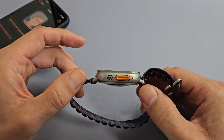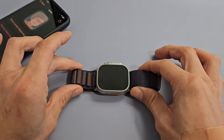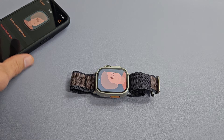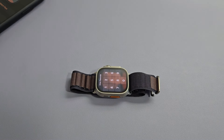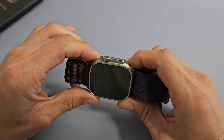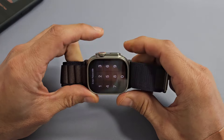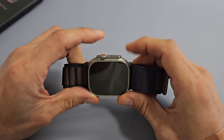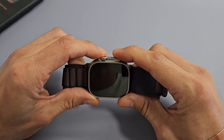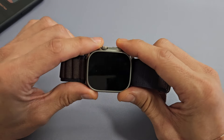What I want you to do is grab your Apple Watch, go to your freezer, put it in your freezer, and leave it there for 15 to 20 minutes. After 15 to 20 minutes, grab your cold Apple Watch, then tap one of the buttons and see if your screen is on. If not, do the same thing again — two-key combination: digital crown, side button. Press and hold both buttons and don't let go until you see the Apple logo appear. Once it appears, let go.